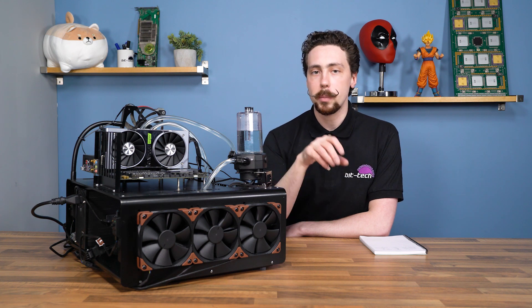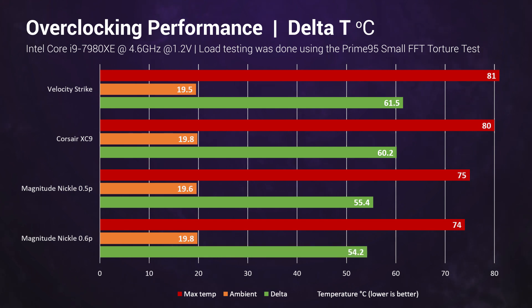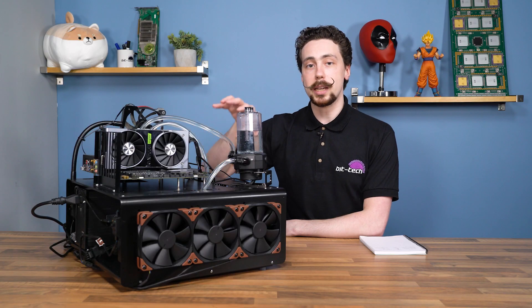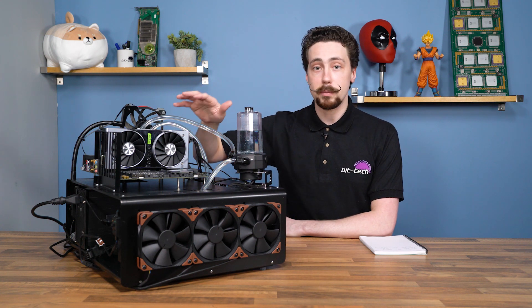We dropped an entire 6 to 7 degrees with that block, and then shaved a further degree by changing out the jet plate. When we swapped to the 0.6p plate we went all the way to 74 degrees — though that one could be within margin of error. The ambient was 19.8 degrees that time, giving a delta of 54.2 degrees, meaning this block was an entire 7 degrees cooler. I'd like to see how that changes when we can push even more heat through, maybe using a different CPU and motherboard, and I'd also like to see how it stacks up against future blocks from different manufacturers.